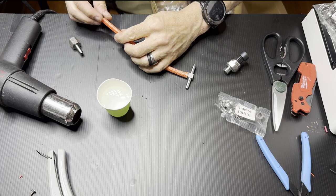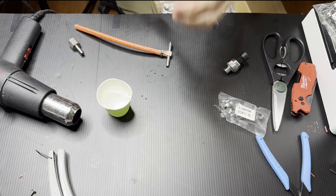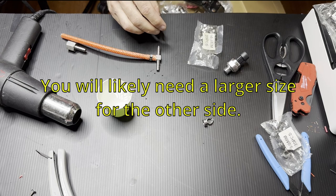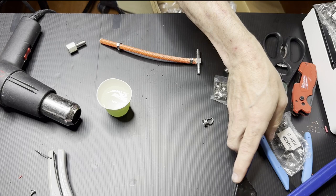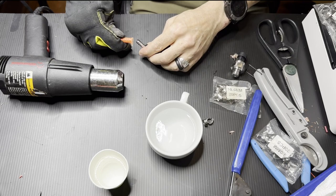I'm using really good hose clamps — looks like a 9mm for the smaller barb and it just barely fits. Use the tightest one that will fit. You may be able to use hardware store hose clamps, but I personally wouldn't. For the other end I'm using a larger one, looks like 10.5mm, but you have to test and see which one fits most snugly while still going on.